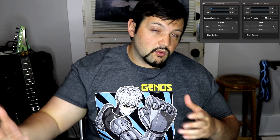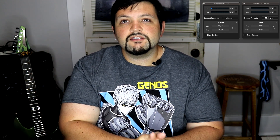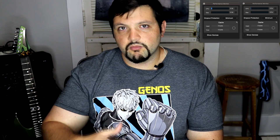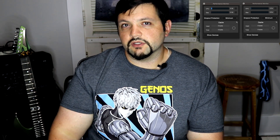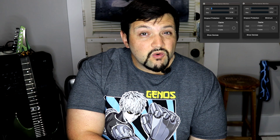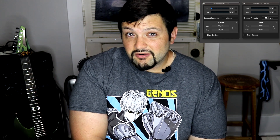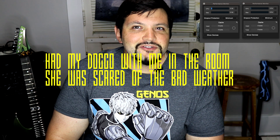So I returned that bad board and got my new board in. I put in new RAM — 16 gigabytes running at 3200 speed, as opposed to the 2666 with my old Intel system. Long story short: got the new board, updated the BIOS again, and I'm now running the new RAM in dual channel mode with the new Ryzen 3700X CPU. Now when I open up that same exact session, the 3700X has 8 cores and 16 threads, and I'm running 16 gigabytes of Ballistix RAM at 3200. My CPU meter now doesn't go past 40, and very rarely goes past 50.